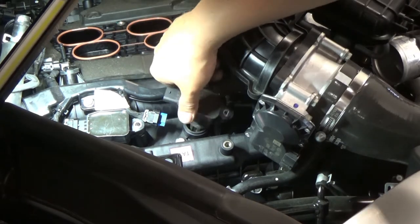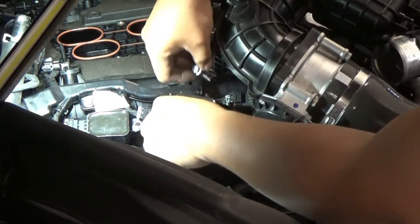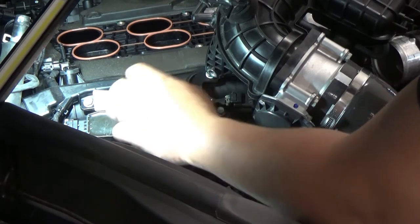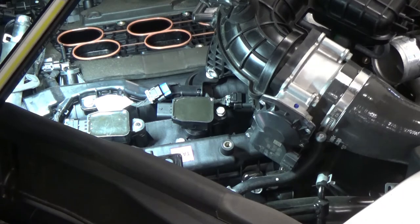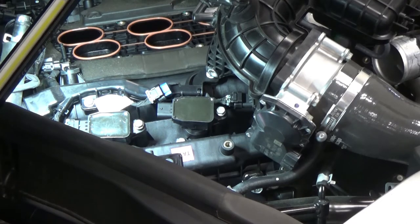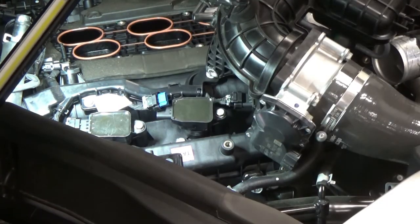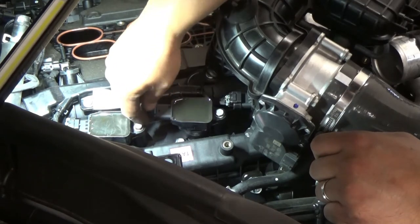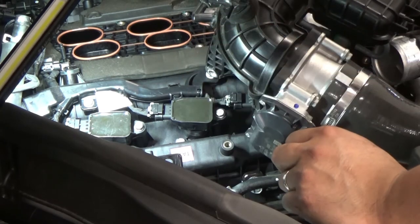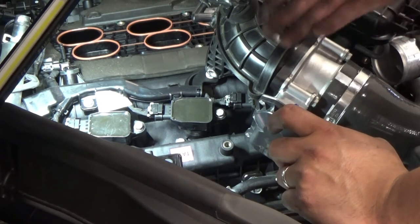I wonder how he removed the spark plug, the ignition coil, when the intake manifold was still there. So that's why I guess there's some damage in this connector, because I was trying to force it. We're going. So let's put this in. Okay. So we're just gonna put everything back together. I guess on that one, I think something happened on the first thread on the hole. Because we can put it in without removing the manifold because our socket can go in there, right?